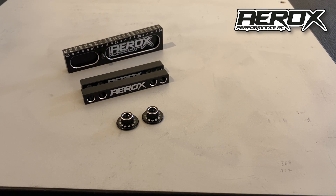Droop is a measurement used to define the point at which the tire leaves contact with the ground. It can be a very powerful tool to quickly change the behavior of a car. Measuring droop to the axle center is the most accurate way of doing so, as it eliminates any potential discrepancy in the symmetry of the suspension components.